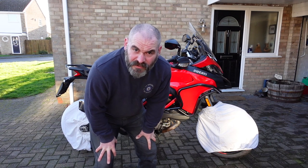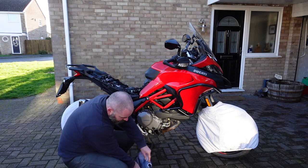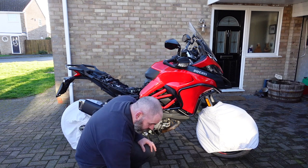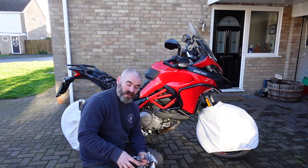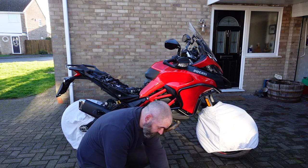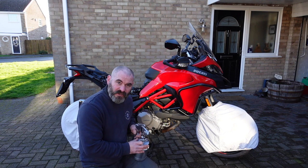Right, I'm going to get some ACF50 into a gun. 95% of the formulation of ACF50 is active ingredient. So it's not like it's mixed with something like water or spirit as a carrier. Virtually everything in there is ACF50, virtually all active ingredient. So a little bit goes a long way.